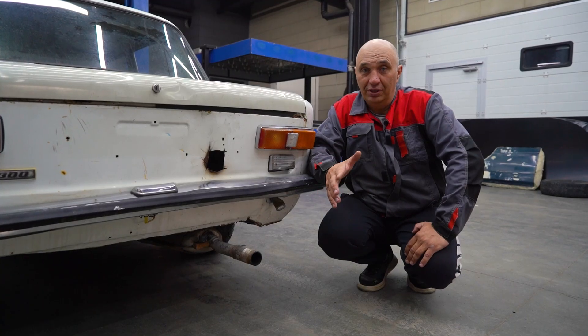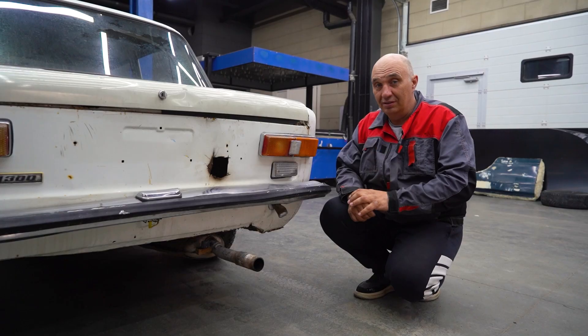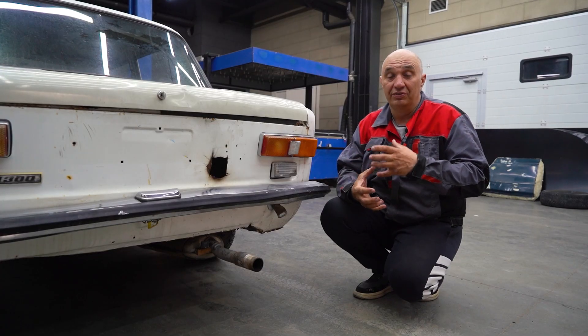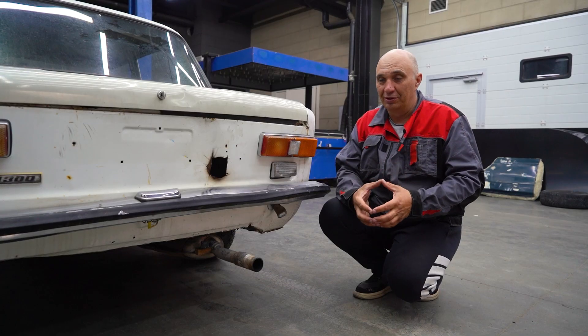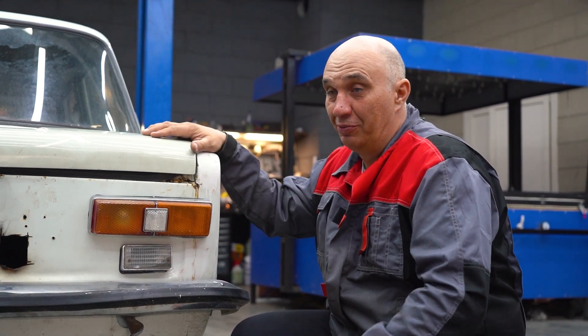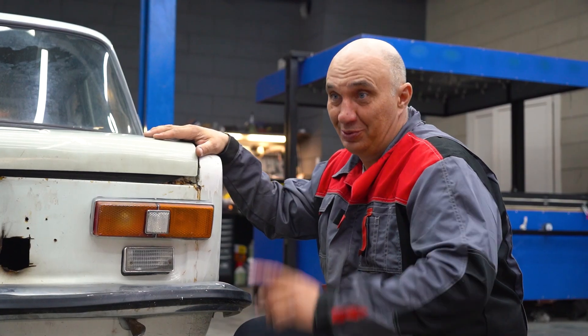The car's gonna be way more eager to decelerate. We got a bunch of people in the comments suggesting we try a retarder. We're gonna try and make a valve that blocks off exhaust flow to create that excess pressure, giving the engine a tougher time turning over, resulting in it decelerating the vehicle much more effectively. Now there are certain limitations, but our plan is to block it off completely and go out to do some testing. Let's try setting up a retarder. Let's do this.